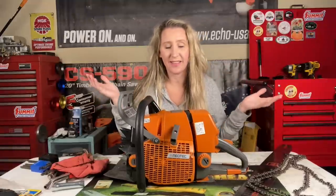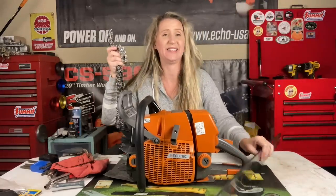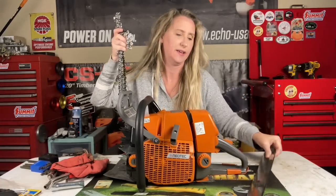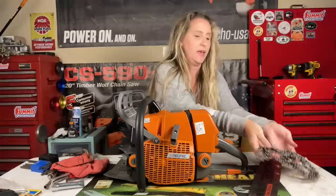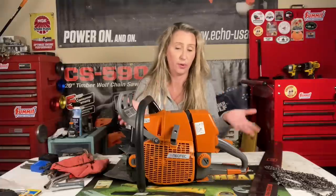You can get this one online for about $389. It comes with a 36-inch bar and chain — I went ahead and removed it because every time I moved the saw around I was knocking over my lights. It is a beast for sure. He said he bought it, started it up brand new out of the box, it was running poorly, and immediately gas was pouring out the muffler. So either the needle's not shutting off, or something else — we're going to figure it out. Hopefully after this video I can save you some time, money, and frustration.